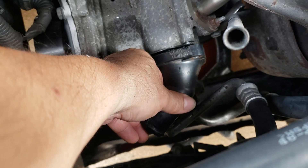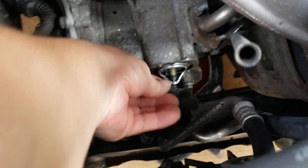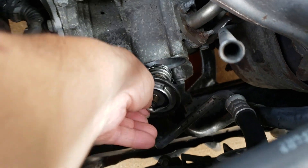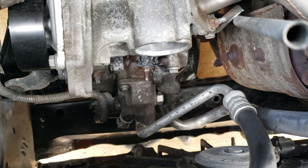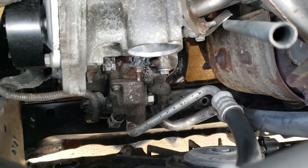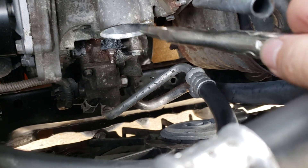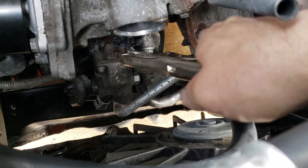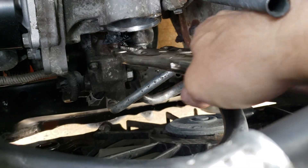It's plastic, so I just snapped it off and broke it — because you have to, it's impossible. I'm not going to spend all this time in here. Take the thermostat housing out, take the thermostat out, and there you are with the broken piece. Now once you have the broken piece, grab it with a vice grip — you've got room now — and you can spin it right out. Look at that!